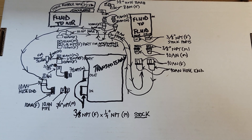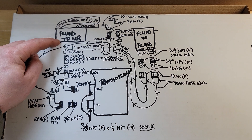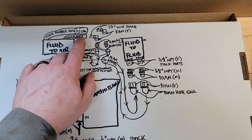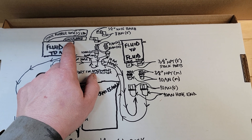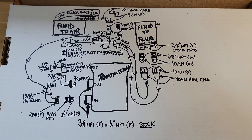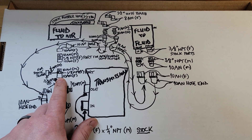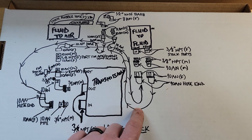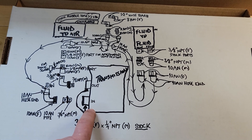We made a diagram for all of the fittings and the fluid flow on the lines between the transmission, the fluid-to-fluid heat exchanger, and the fluid-to-air exchanger at the front. Keep in mind that with the fluid-to-air heat exchanger up here, we're keeping the stock rubber hoses intact and the ends of the lines we're making are mimicking the ends of the steel lines that go into the half-inch inside diameter hoses that are stock. You could go all the way up to the front and replace those with your own lines if you wanted, but we're ending it here. You can pause the video and take note of everything in this diagram before you make an order for your fittings. We're going out of the transmission hot through some fittings — one for the stock transmission temperature sensor, one for my own sensor — then out through the fluid-to-fluid heat exchanger, back out through the fluid-to-air heat exchanger, and then back into the transmission after it's all been cooled.